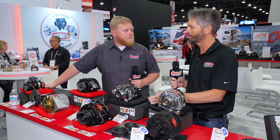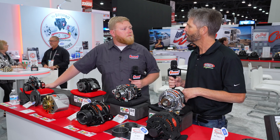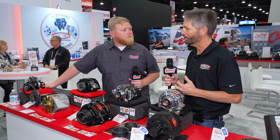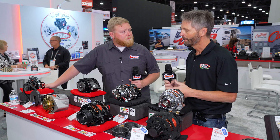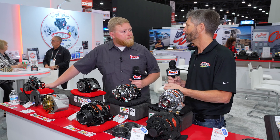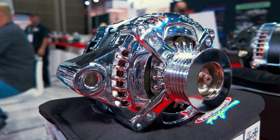But you spend most of your time at lower RPM — sitting at traffic lights, sitting in lines. Even with overdrive transmissions, engines are running at 1800 RPM. With all that current being drawn by everything, we've really focused on the internal design and materials to make a lot of current at low RPM. Our small frame HPR alternator will make 145–150 amps at idle and up to 175–180 at higher RPM. For late model cars — LS, Hemi, Coyote — we're looking at 195 amps at idle and 250 at top end.